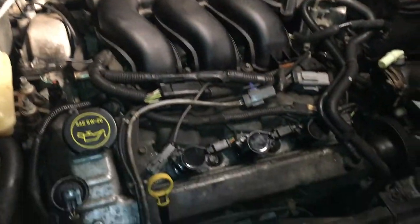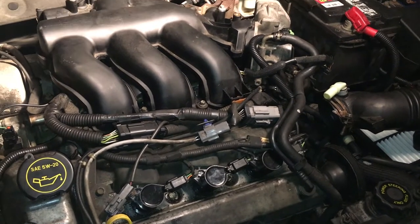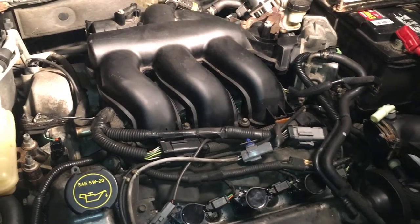What we have here is a 2006 Mazda 6 with a three liter. I'm a few weeks in, very tired and very frustrated. After replacing the first three spark plugs and coil packs it ran fine for a day. The next night I decided to tackle all that — yeah, I did the last three. I have a surging issue at idle. So far I've bought a used throttle body and a used pedal as well, about 40 bucks. I took a gamble.